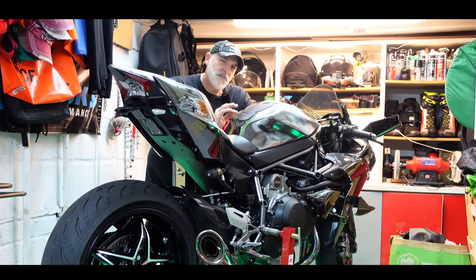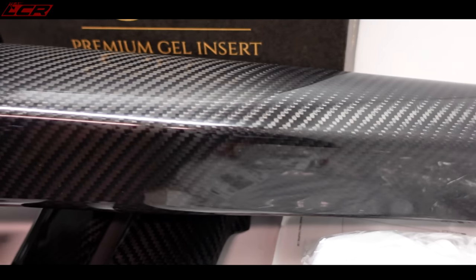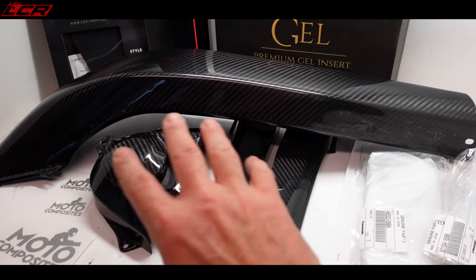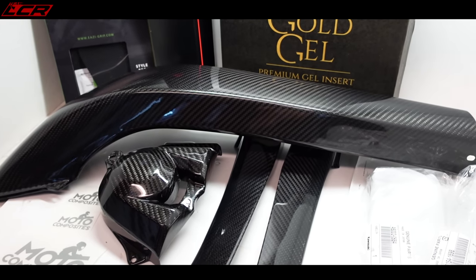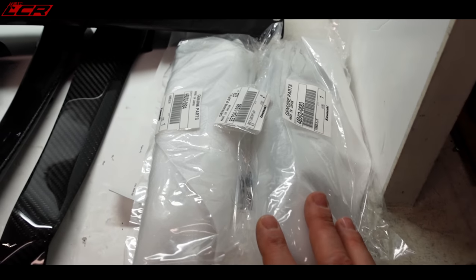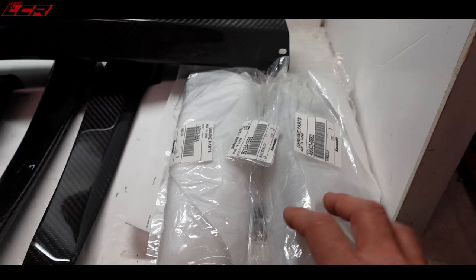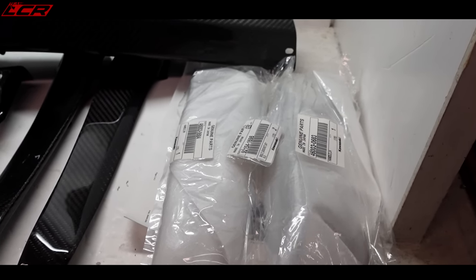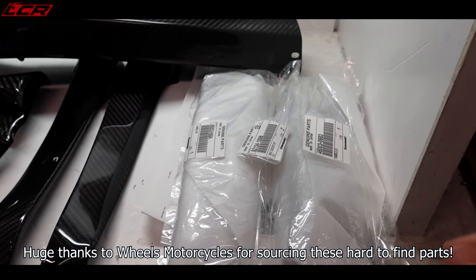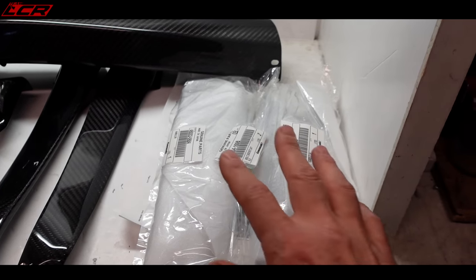Let me take you through some of the parts I've got for this bike to make it more comfortable. The carbon fibre isn't going to make the bike more comfortable, but I can't do a project in the garage without adding a bit of bling. So I've got some Moto Composite carbon fibre to add to the bike. I also have some genuine Kawasaki risers — Kawasaki actually make an official riser for the bike. These are 20 millimetres higher than the standard H2 clip-ons, which will give me 20 millimetres of extra comfort on the bars without going too silly. That should take enough weight off the wrists to make the bike feel a bit more like the S1000RR.